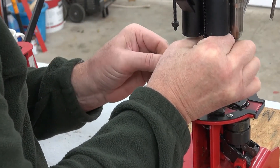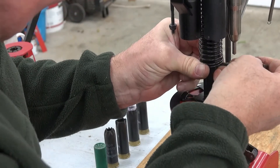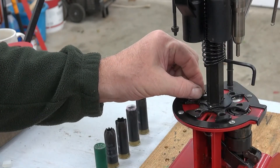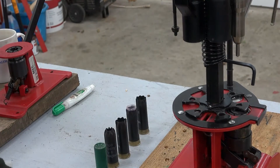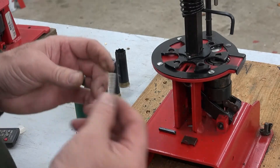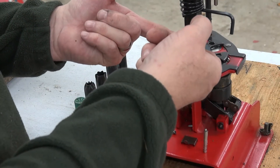Okay, I got the spring locked up. There's a pin right here — it's freely moving, held in place by the coil spring — so you can remove that. I've got these two pieces pulled out now. I like to keep a magnet handy to come in here and pull that little ball up. You can see I've captured the little ball bearing there — I'll set it over there and it's going to stay with the magnet. Now I can lift up on this piece here.